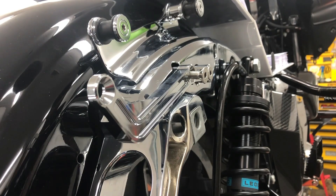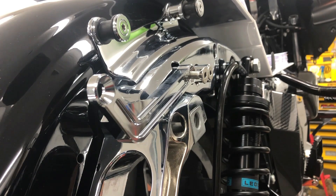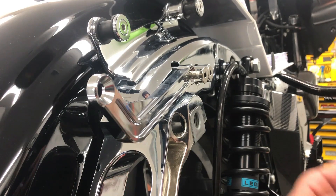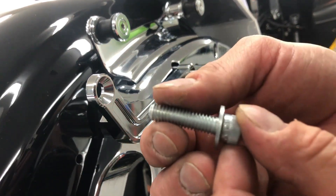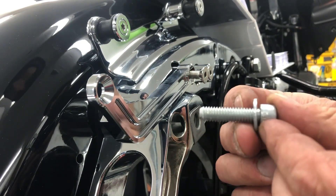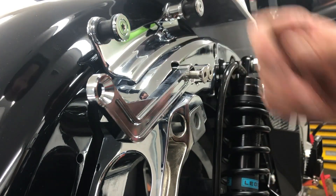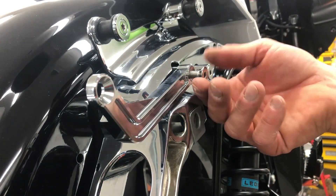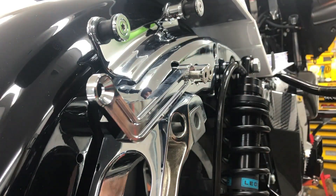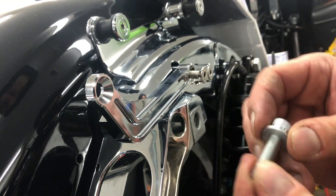Here's a funny one. I'm just going over the original Garage Moto instructions for the installation of the reservoir mounts. So whenever you pull out your hardware — the stock hardware — there's a captured washer here that actually acts as a spacer. Original Garage Moto does not supply a spacer since we're reusing OG stainless hardware, so you kind of lose this captured spacer.